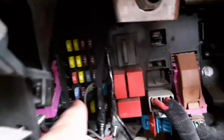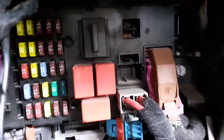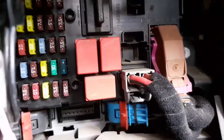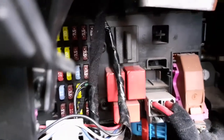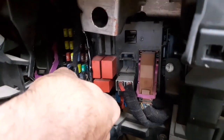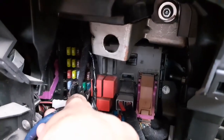This is the fuse box in the dashboard. As per the map we seen online, it matches exactly here. According to the fuse map, the cigarette lighter socket fuse is this one — F44. So we need to check this fuse and we have to replace this. Use some kind of pincers like this to remove the fuse; it's hardly reachable by hand.